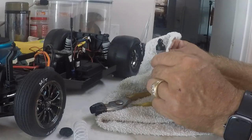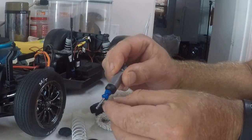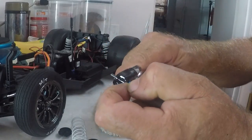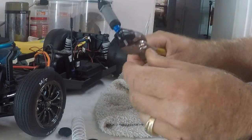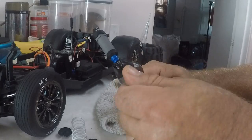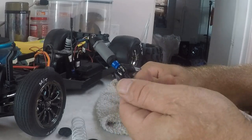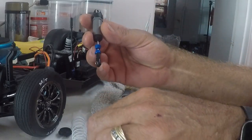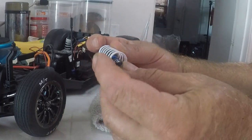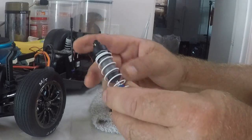Quick wipe on the pliers too because they get slippery. Then you want to put your bottom-out dampers back in — the cones go together. You'll see you took away some of the shaft length, so push these down a little bit. Put your pliers back on — nice and tight. Flip it around, threads are all exposed. You don't want to over-tighten this — you don't want to crack the coupling, the turnbuckle. Screw it back down and snug it up. Then put the top spring retainer in, put the spring back on, put the lower retainer on. Boom — you've taken out the play, that easy.